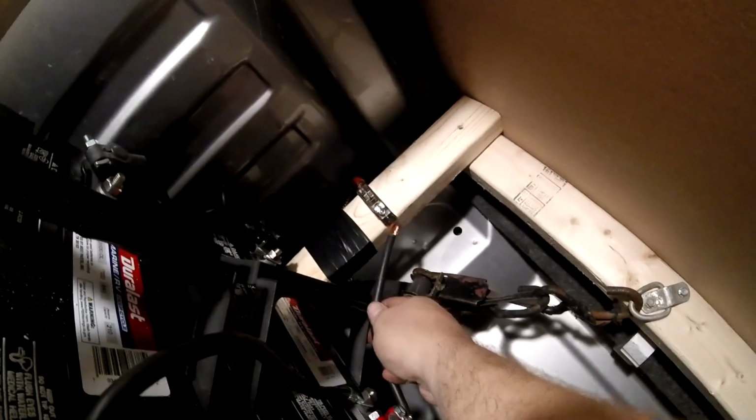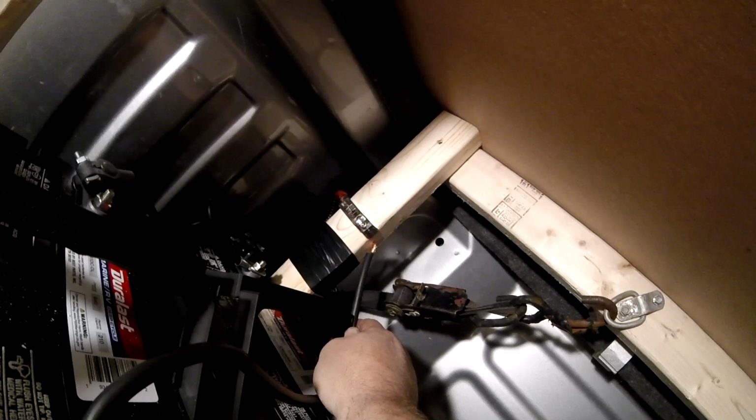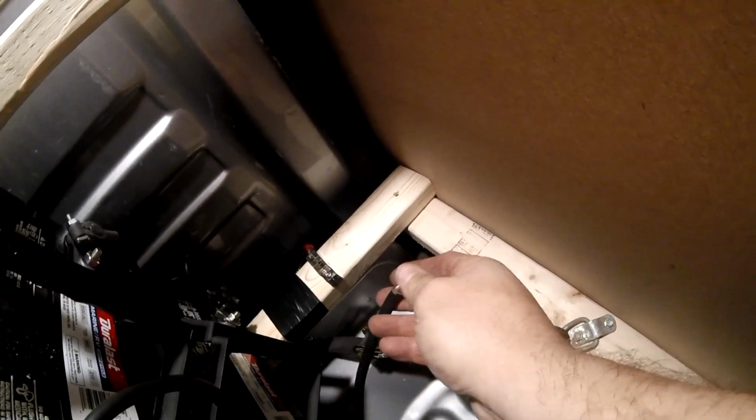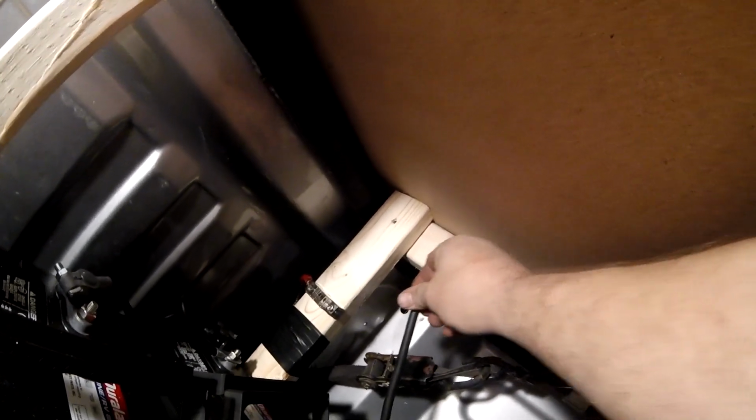Now, in addition to that, the other thing I'm going to do is tape it to the handle. I'm going to tape it right there, so it's extra special, super duper not able to do that. Why am I taking so much care? It's that important, guys. Everything from here down is fused, but everything between here and here is not fused, and you will melt your truck to the ground. So, all right, guys, I'm going to get this attached, and then we'll throw some fuses in there.